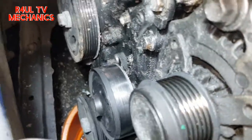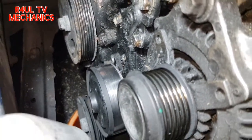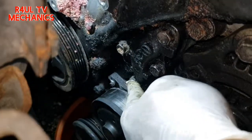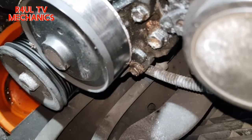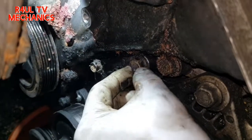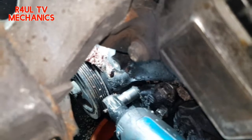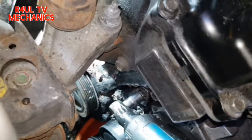I've sent the car down. Now I'm gonna take these top bolts off — can't really get it wrong. There's a 10mm bolt here, another 10mm just there, and one more in there — take those three off. Then there's a 12mm bolt here, another 12mm there, and a 14mm bolt here as well. Take all of those off and hopefully the water pump should come straight off.